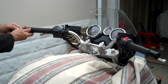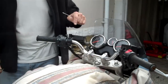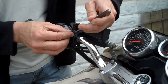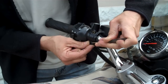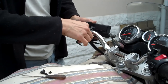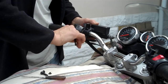First job: whip the mirrors off, then whip your bar-end weights out — these can get real stuck. Take the levers off. If you've got any of these caps, take a little flat screwdriver, gently get it underneath and just whip them off. Now these are on their connections — you do not need to disconnect any of the hydraulics or electrics, it's just not necessary. You'll see they just hang on their cables.